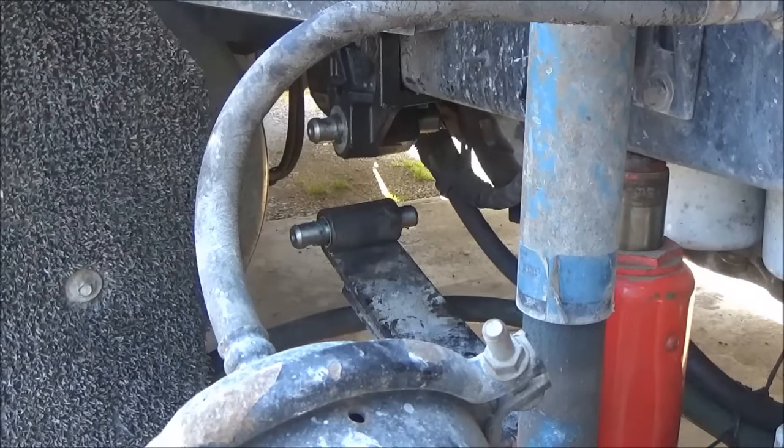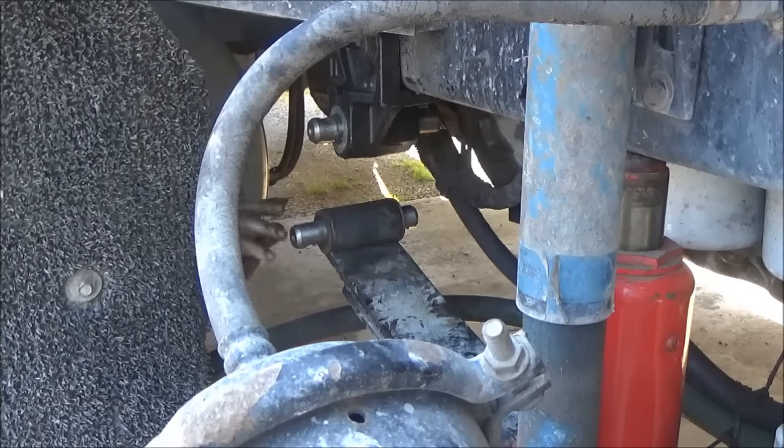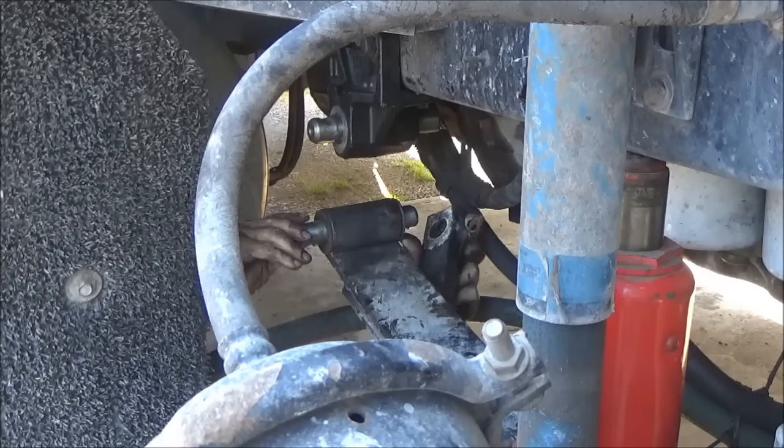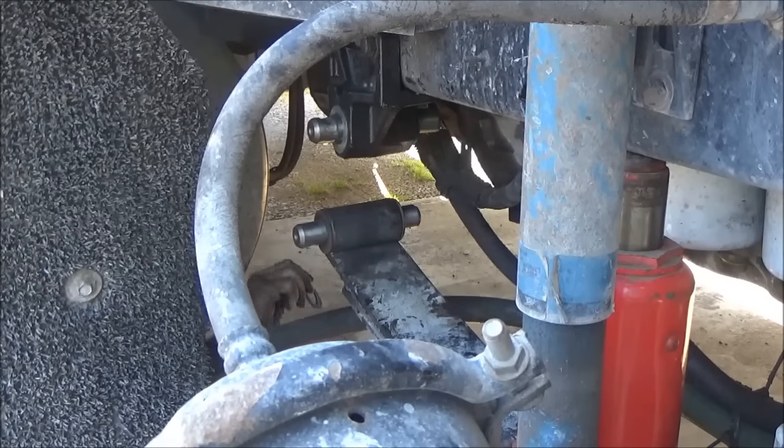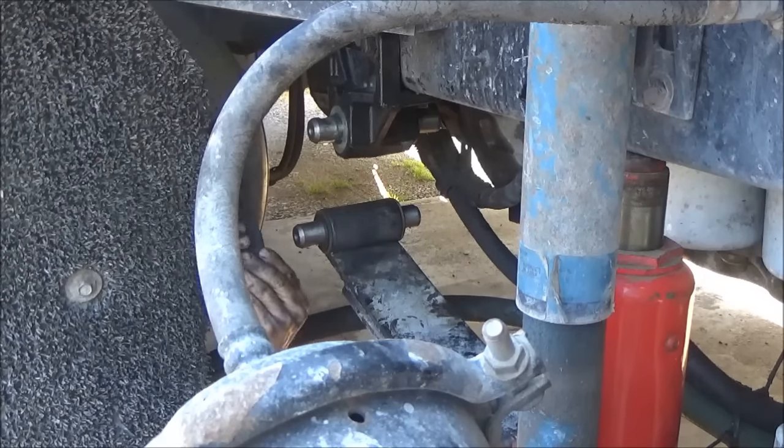First, I'm going to space one of these heavy washers over here, another heavy washer on that side. I'm going to adjust that pin to where it looks like it's in the middle. I'm going to put a few little spacers, about the same amount on each side. I'm going to do three right there and over here. I'm going to pick the best side of these aluminum shackles.